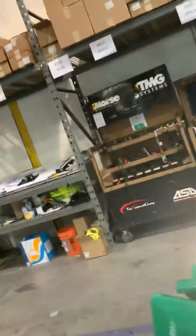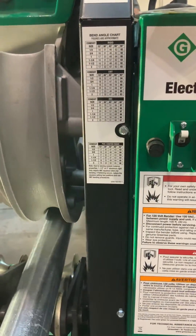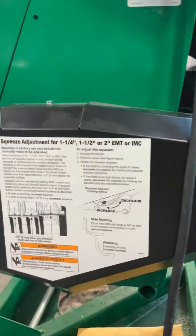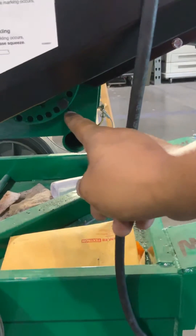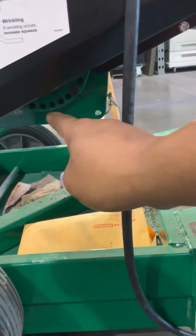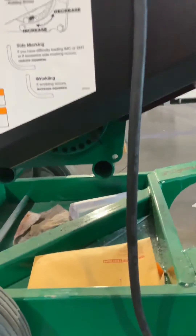The chart is right there — boom. Sometimes you've got to adjust one over, so you just set the tension. If you still have ripple problems, go to the side here — see 'increase.' You turn the wheel right here: take the screw out, put a mark, turn the wheel. You can stick a screwdriver in the hole to turn it, pull the screw out, put the screw back in, and check your tension.